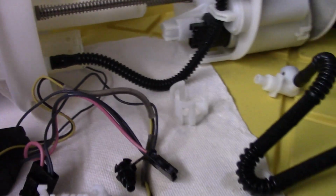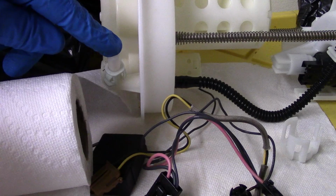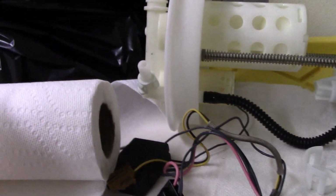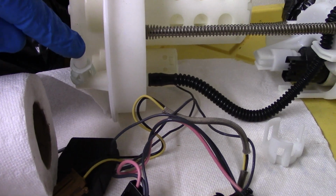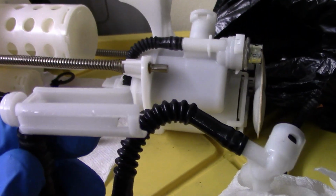So people screw this up. They always use this as their feed, and this right here, I got my RSX to run perfectly normal, no running out of gas. I can run it down completely low. This should always be your return right here, and it's going to replace this. This is going to feed in here.